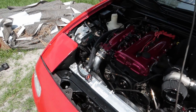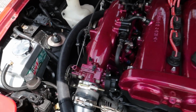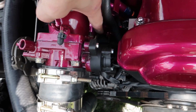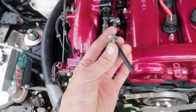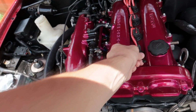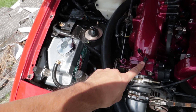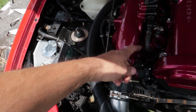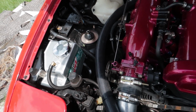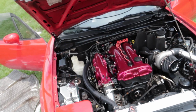So it's now the next day, and I've been going over everything to work out why it was idling at 2000 RPM, and I was exactly right. One of the little blocker things here popped off down there on the intake manifold, so I've just rigged this up with a little bit of a vacuum line and a bolt. I'm gonna slide that on there with the zip tie, and that'll get this thing idling normal again, and then we can get this thing to the shop, and I'll go to AutoZone and buy some smaller ones of those that are actually designed to fit that. We'll get the zip tie on there as well, and maybe a little hose clamp on that one, because it seems like that one likes to pop off a fair bit. So let's do that, and we'll take this thing for a drive.